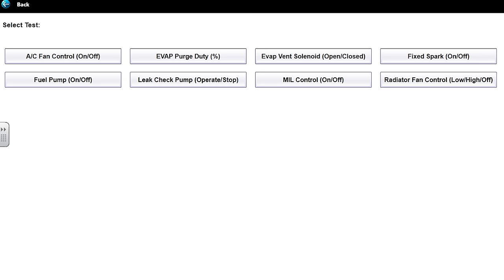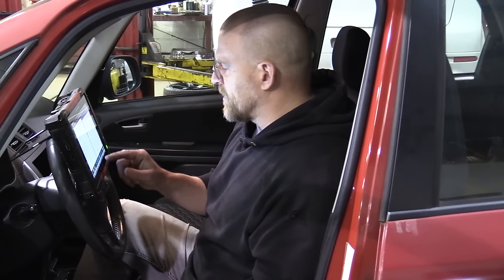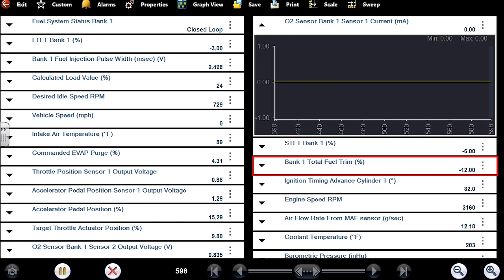It's not letting me control the purge valve with the engine running. Under the global data it was giving me better-looking zero numbers and it was moving. I just want to richen the mixture and see what it does. It has been compensated for. Pretty freaking rich — total trim is roughly 30%. Short-term plus long-term together, and they're updating a little at different times. Total trim is around 28% at idle. At higher RPM it's significantly better. I believe this oxygen sensor data parameter is unreliable.